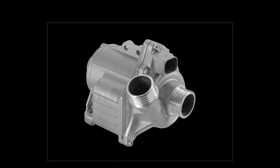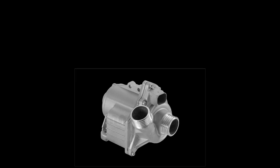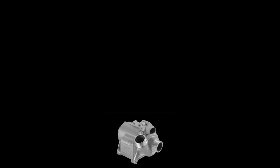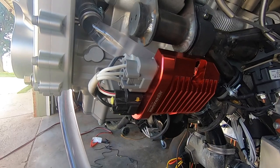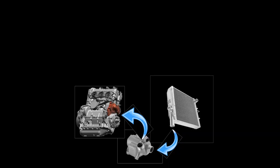So let's talk about how I have all of this routed. Starting with the heart of the system — the pump — it's down at the lowest point, just off the cold side of the radiator. From there it routes up to the water pump housing built into the SkyTrax box that we looked at last time. It enters the passageways in the engine, but also branches off into three additional loops. The first one comes off the top of the impeller housing, up to the main water output line leaving the head. I believe this is mainly an air escape path, but I'm not exactly sure — I'll be leaving it in place since it won't hurt anything.